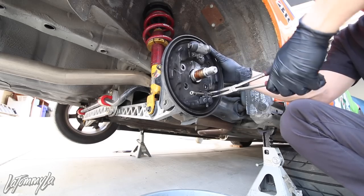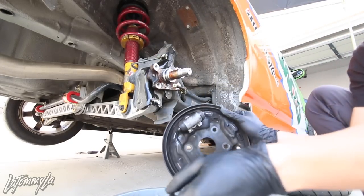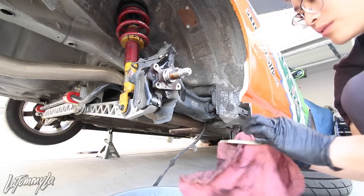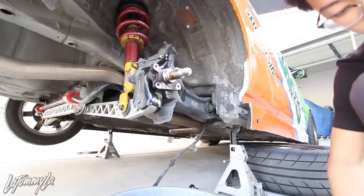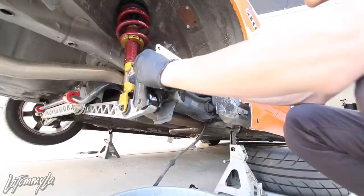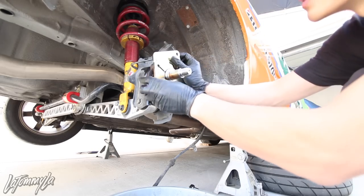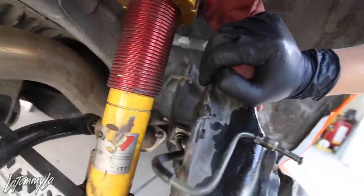Make sure you pinch off the e-brake cable so it comes through. Alright. And there's the whole drum assembly. The e-brake cable, we're gonna do that later. Damn, I hate how they don't label what direction is what. I just wanna make sure these are right. It fits better compared to doing the other side or the other way. Let's see. Yeah, they feel loose. Alright, before I do that, I'm gonna take off the brake lines. This whole cable right here.